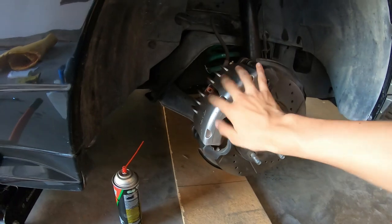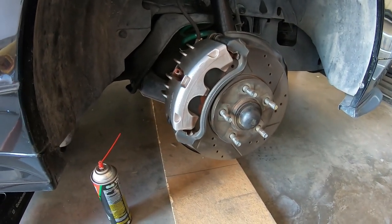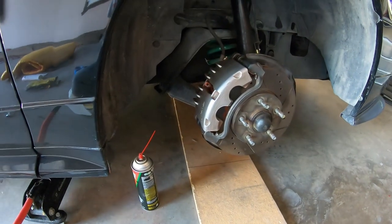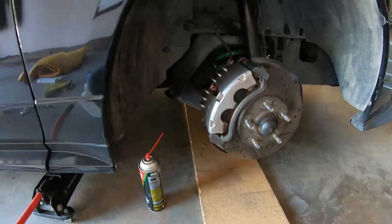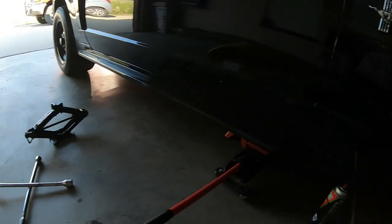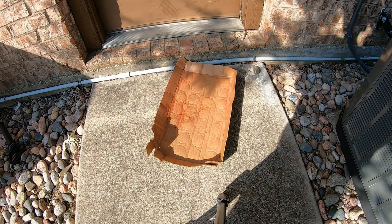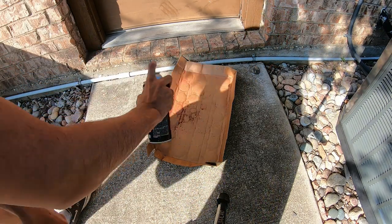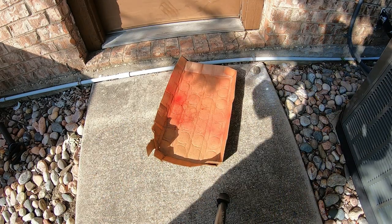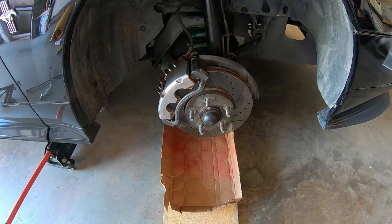After doing the process we are ready to paint - I put my hand all over it and it doesn't come back dirty, it's clean. For people who've never painted before, shake the bottle for about a minute. We're going to use the gatorade box cardboard and go to the backyard to practice. Take off the top and be about eight to ten inches away. We're going to do a swaying motion starting from top to bottom - just sway back and forth. There we go, we got it down. Let's get back in the garage and get ready to paint.